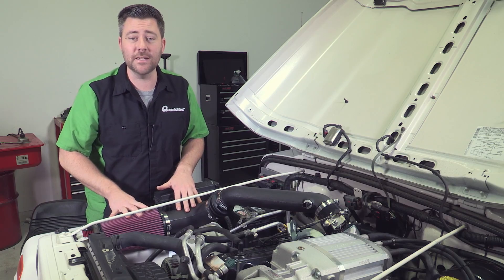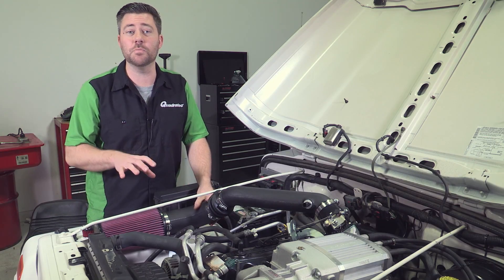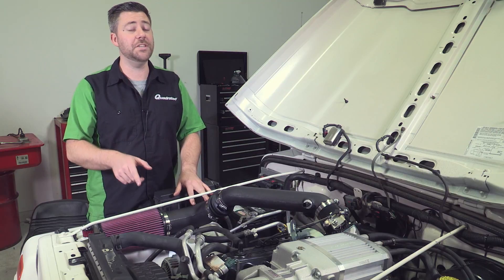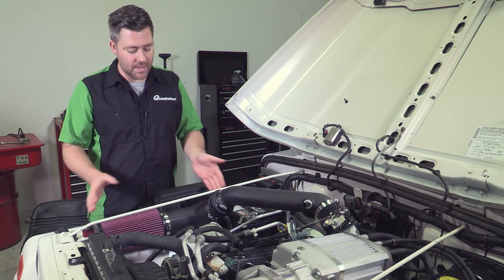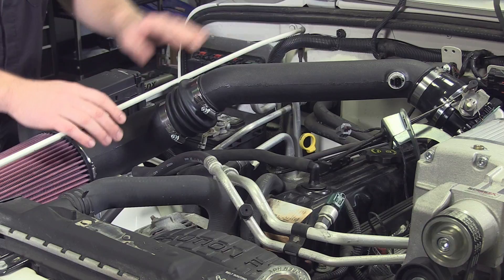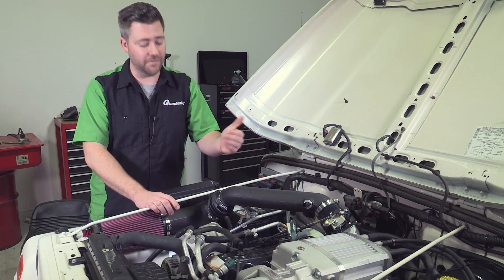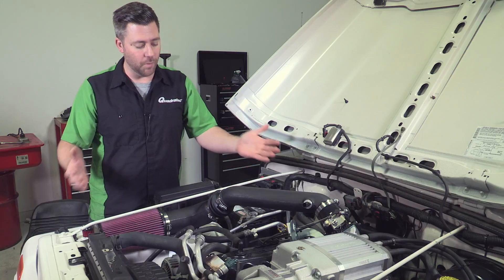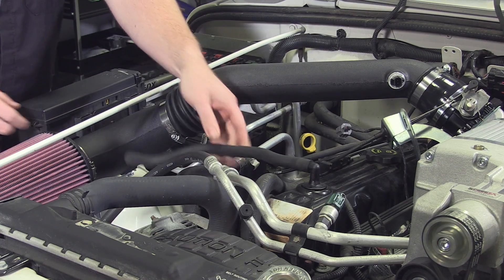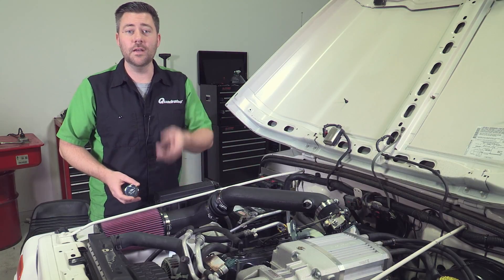This particular air intake kit does not have a port for us to connect this hose. Now we knew that when we picked out this Airaid kit for this build, but we picked it out for a very specific reason. This kit was actually designed for 2004 and earlier Wranglers, whereas Mike's TJ happens to be a 2005. We did that because this kit only replaces the factory airbox and connects to the upper tube in a factory location. When we installed the Sprintex supercharger, it moved the location of our throttle body, and Sprintex supplied a new upper air intake tube that connected to the factory airbox at a factory location — making this Airaid kit the perfect choice. We're going to go ahead and remove this vent tube, replace it with a K&N filter breather, get our IAT sensor hooked back up, and then move on to that oil catch can.